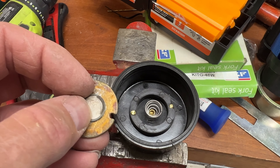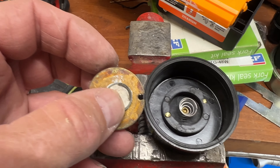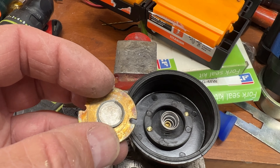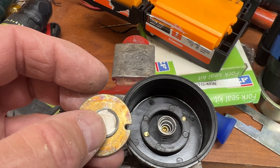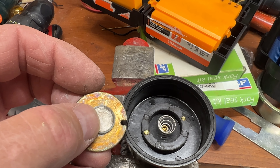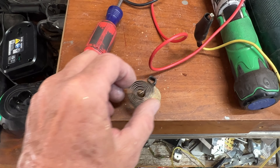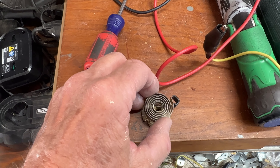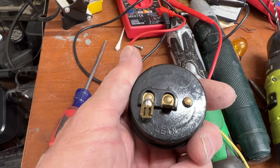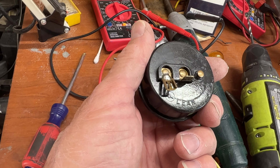This one stopped working, so I bought a new one — the new one works fine. I measured the current draw just to see, and it only draws about one amp, which is plenty to get hot. It gets good and hot in less than two minutes — usually by about a minute it's already started to pull the choke off. One thing I discovered is that the first replacement I bought had the spring going in the wrong direction when it heated up. You do need to pay attention to that. You can see this one has a label that says 'lean' with an arrow — you turn it that way if you need to lean the choke out.